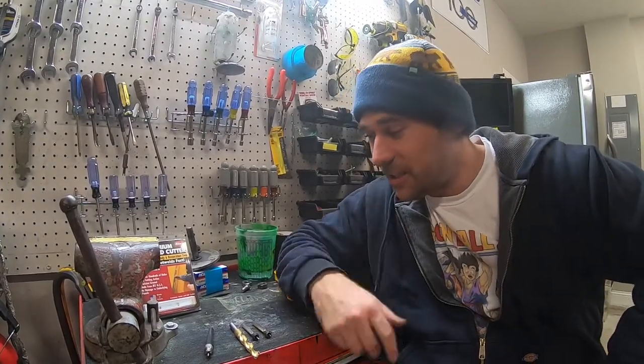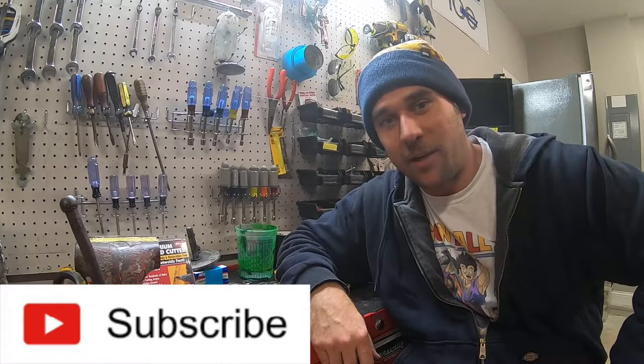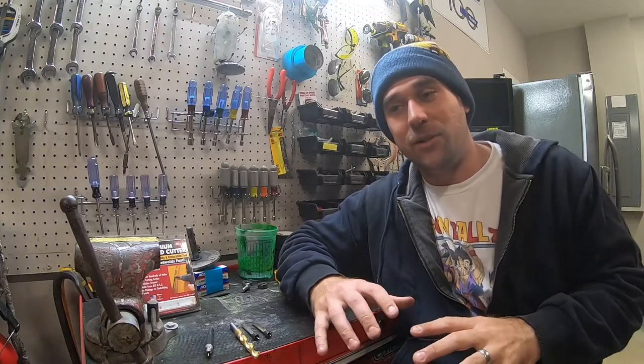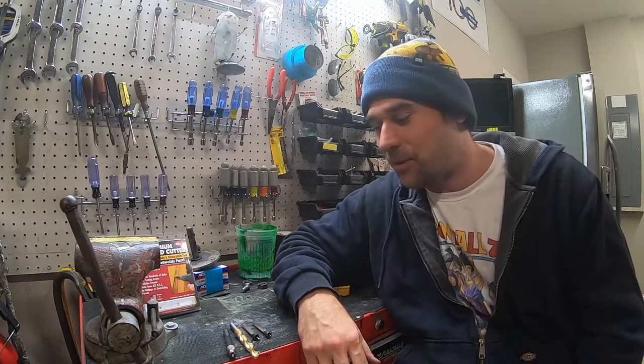If you like what you see and the tool reviews, you know what to do. I'd prefer you leave a comment because I'm more about the progress and the learning. Subscribe if you want, but I'd rather you contribute. If you've got a better tool than this, please share it. I've seen guys shoot them out with a plasma cutter, but that's besides the point — I don't want to blow a hole through there. The goal is to eat through the top layer and leave the bottom layer intact so we can weld our new welds to it. That's how you want to do it.